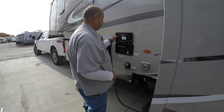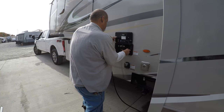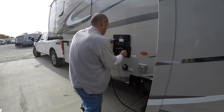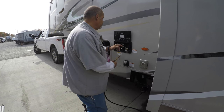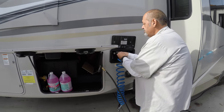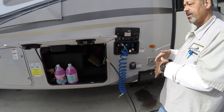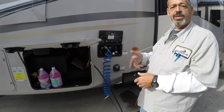The safe number to be on with that pressure hose is 45 or 50 pounds. With 45 or 50 pounds the burst can be a little longer, but just don't keep it on there. What we're going to do is push all the water from all the faucets into the black tank and the gray tank, and then we're done with everything. We'll take it over and dump it. When you're blowing the lines, it's just pushing everything into the black tank, so you don't have to have the nozzles pulled. You want to make sure they're closed, because you don't want to dump it until you're done with everything.